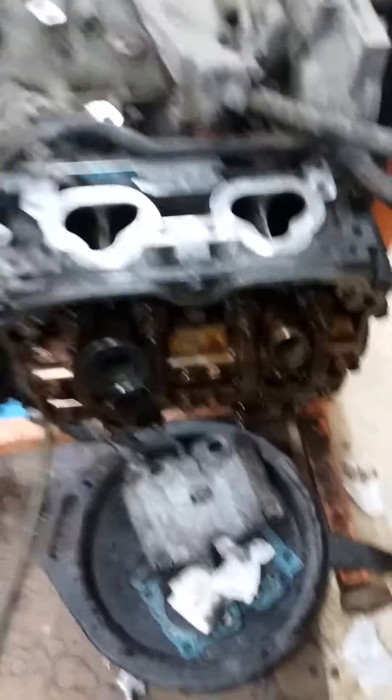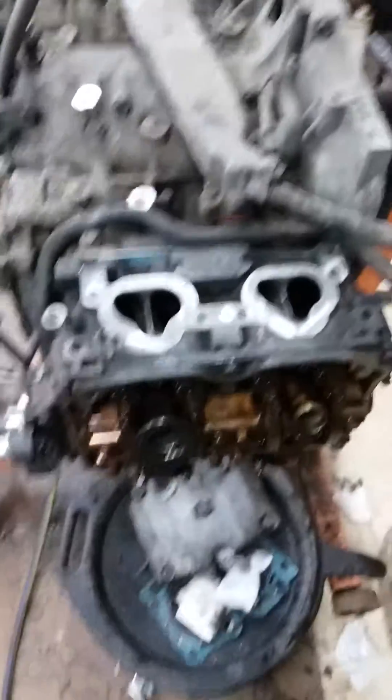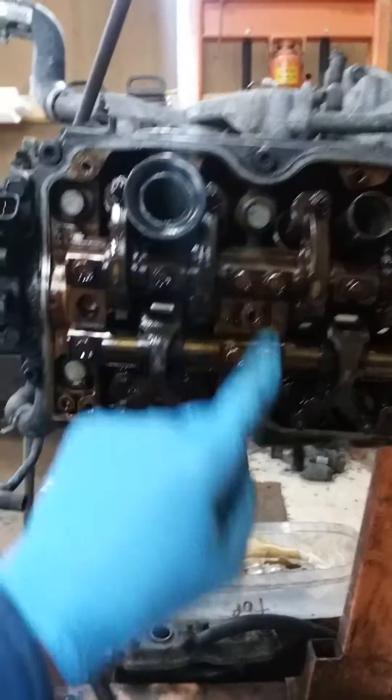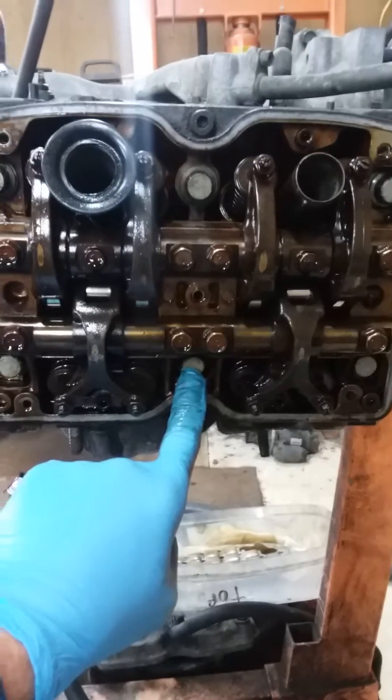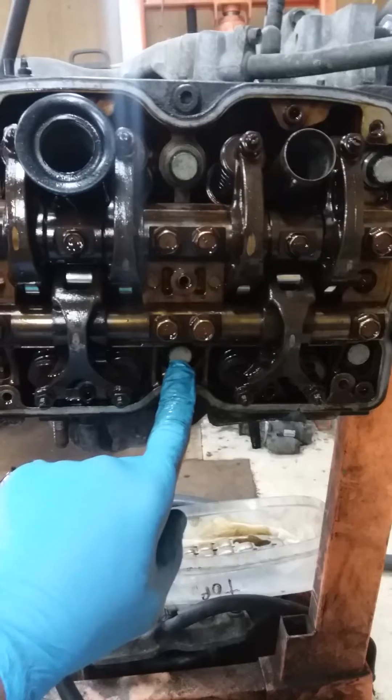The other thing — don't reset your torque. Do this side at 35, then do the other side at 35. It allows this side to kind of cool down, because bolts heat up when you keep running them. Take your time with it. Increase it 10 pounds every time until you hit 75. Then, once you're at 75, take only the middle head bolts — this one and this one — and increase those to 85 foot pounds.